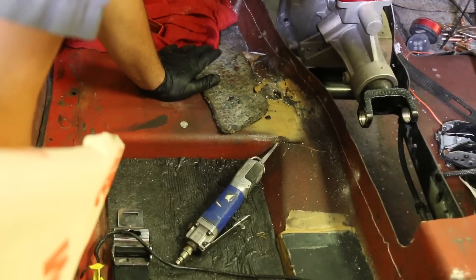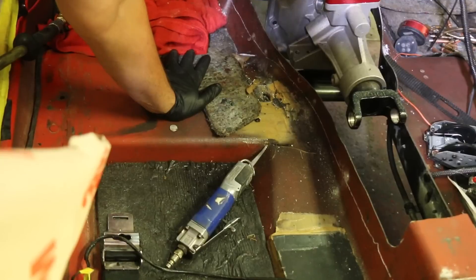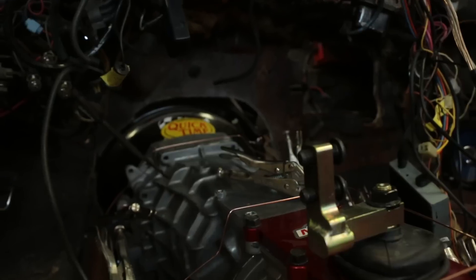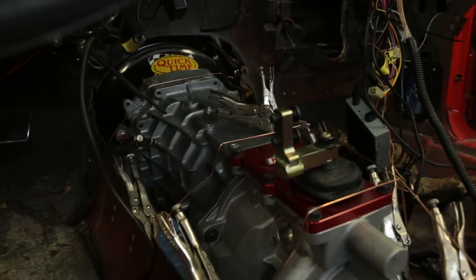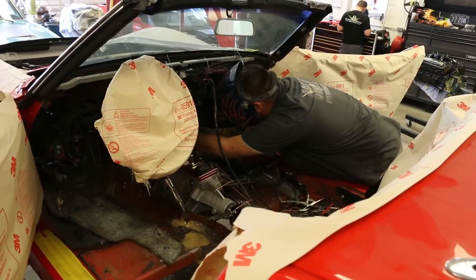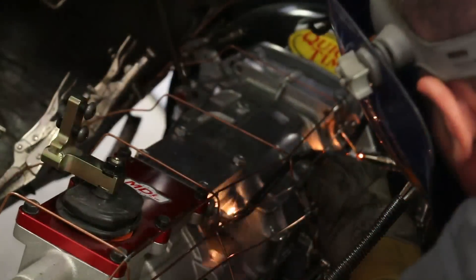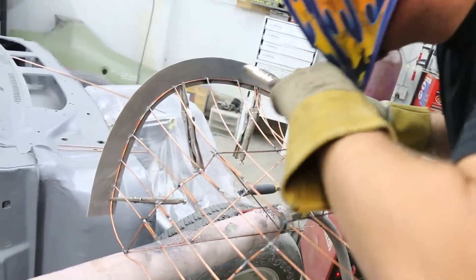When you're cutting into fiberglass you have to assess how to properly bond your pieces back in so that it's strong and safe, and then you've got the aesthetics of how the inside of the car works. The console doesn't have a lot of extra space, so moving the tunnel up creates some challenges, especially since the owner wanted the interior to look as stock as possible. Working with Modern Driveline, the V8 team ended up making a mold so that the new tunnel could be replicated for other installations. The crew is itching to build the new fiberglass transmission tunnel — see it happen when we come back.